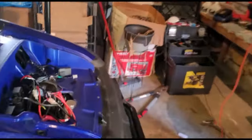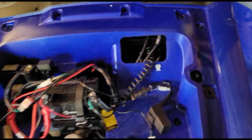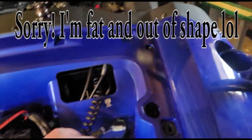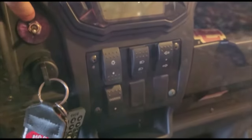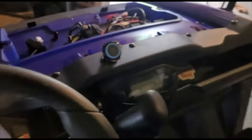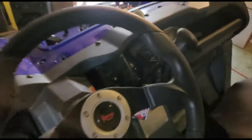Coming up here to the hood area: here's your battery, your brake fluid is right here, and your horn is down there. I bought a Boss Audio sound bar — I've got a separate video on my page on how to install that; I ran the wire down and through here. One thing I just did recently: there's a hole in the dash with a rubber grommet in it. I took that grommet out and installed a switch — it looks purple on camera but it's actually black — with a big washer. Now you can turn your speaker on and off. Otherwise you drain your battery.